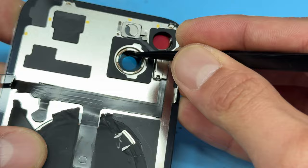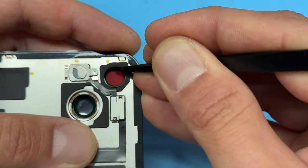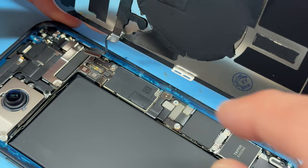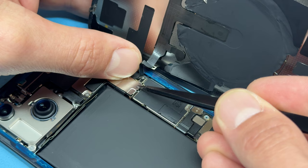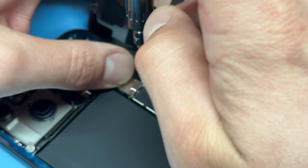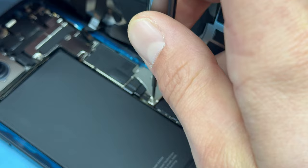There are a couple of plastic films inside the camera lenses which are difficult to remove as there's nothing to grab onto — just be careful when removing them, as this is honestly the hardest part of the job. Now we can get our prepared chassis and line up this flex cable first, applying pressure once the connector is lined up. Use tweezers to line up the shield — it's got a funny little slot and a clip that connects it, then the single tri-wing screw that holds it down. Make sure it sits flush, then move down and reattach the battery connector, including the shield with its clip and the two tri-wing screws. Finally, peel off the last layer of the dust and moisture resistant adhesive.